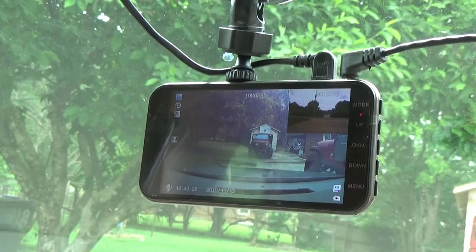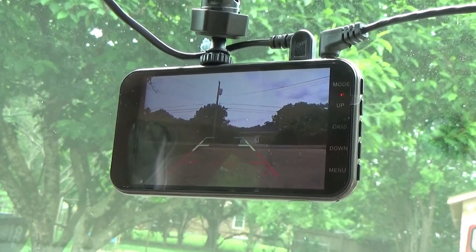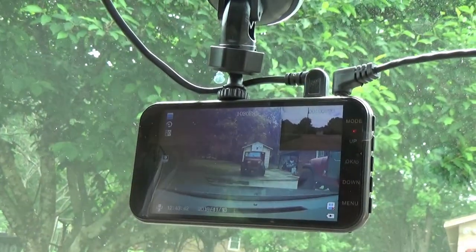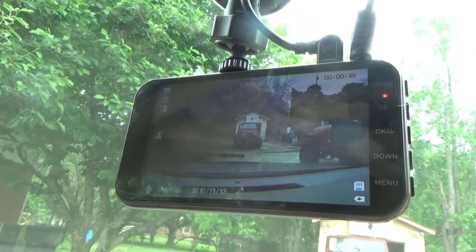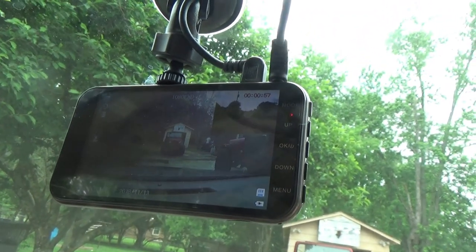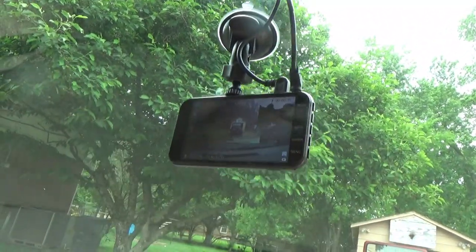Put your taillight back in. By hooking up the red wire, you can see we're in standard mode right now - as soon as you put it in reverse, boom, it flips into full backup mode and you get the whole screen so you can see when you're backing up. Take it out of reverse and it goes right back to standard drive mode with picture-in-picture. This is your front camera and this is your rear camera - pretty sweet! If you learned something, give me a thumbs up, subscribe if you haven't, and leave some cool comments down below.